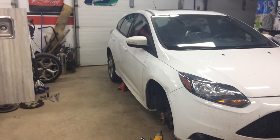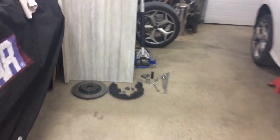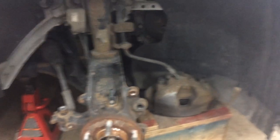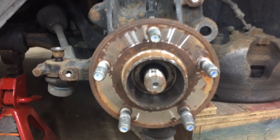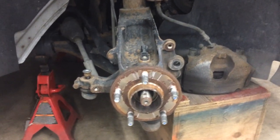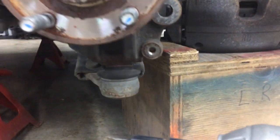I have to do a wheel bearing, so here it is. You guys are joining us late here. I started by pulling the brakes off, the dust shield off, and the axle nut — so you guys already saw how to take the brakes apart. We pulled this nut off; that's a 32mm and it comes off pretty easy with an impact. Took the brake dust shield off — that's a 10mm, a few bolts.